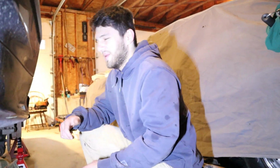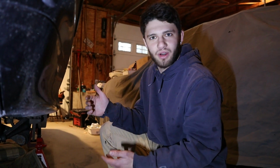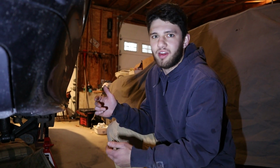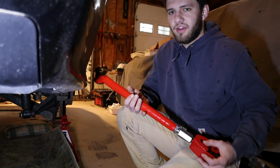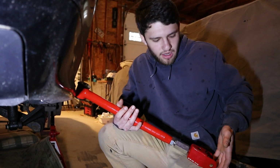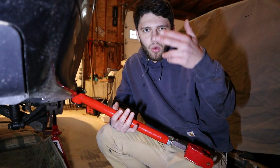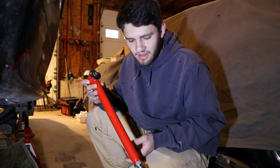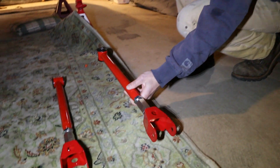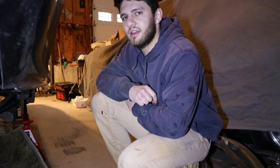The other BMW I owned, and on this one, we've had a pretty significant amount of rear wheel camber, and doing burnouts and everything, it just wears the whole inside of the tire and destroys it. What we're going to do here is, instead of having that camber sag, shorten the length of the control arm and bring it back to get more even tire wear. Hopefully we won't blow off a tire in half the time. Right. Give us a little bit more tire life and some more traction too, because if you're only using a little bit of your wheel, you're not getting any traction.